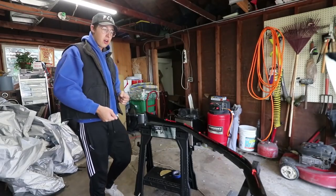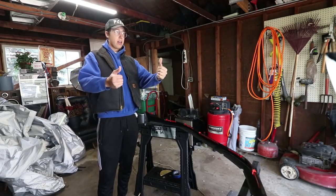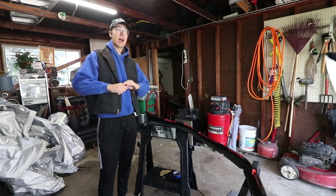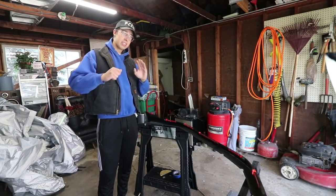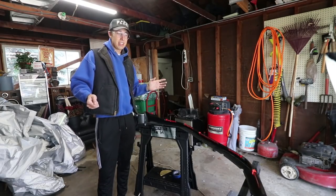Hello and welcome to tomorrow. The lip is now dry. I can go ahead and jack the car up and get it ready to install this lip. In the past I've been a little sus with how I've done 3M double stick tape, but this time I'm gonna take extra precautions to make sure it sticks really well. We're gonna put the lip on the car, screw it in, and then peel the tape and it's done. I'm so close, so happy. This project has literally been taking like four days.